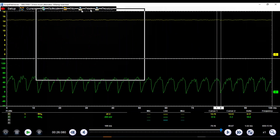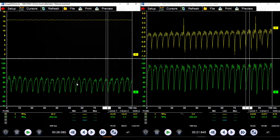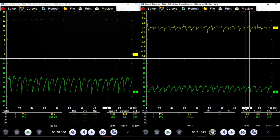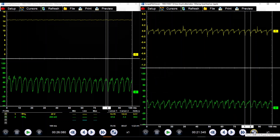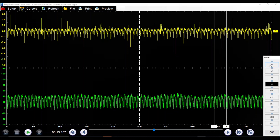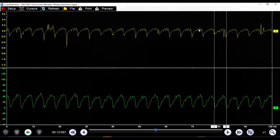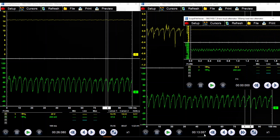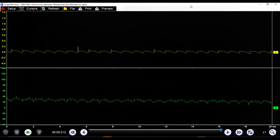So we put these side by side. You can see under no load this is what's going on, and then right here is our high load. This is before I turned the load on. You can see how we have these even humps and then it drops down. Like this should be an even hump — we shouldn't see this pattern where we have a couple and then a drop down. Now let's bring up our new alternator.